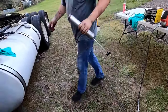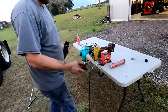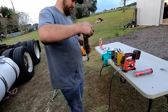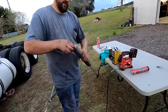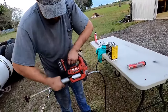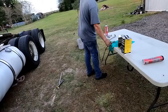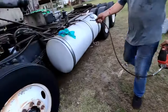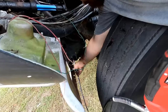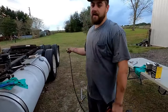We slide that out, grab a pair of pliers — be very careful with this thing because it will cut you so fast. Shove it in there and pop the top. These are nice because they bleed themselves out — the old ones you had to sit there and mess with every time you change it out. Okay, we got the front leaf spring pin greased. Now we're going to do the same on the other side, then move on to the back.